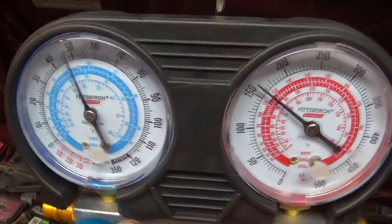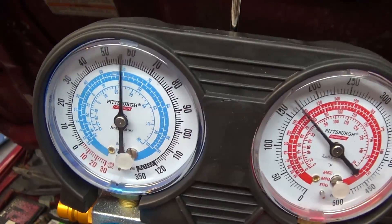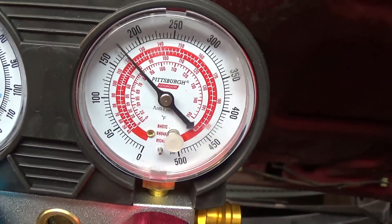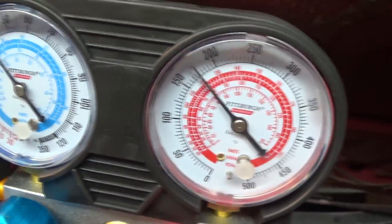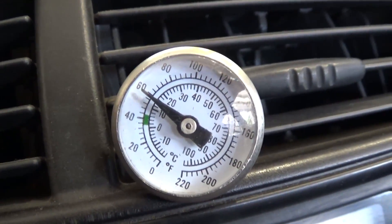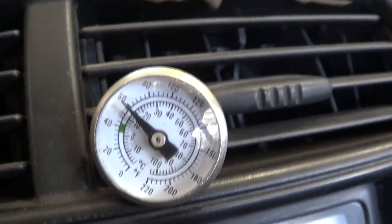It's pretty hot in here, so I'm going to give it a bit more charge — I'd say like low 40s PSI. High side is holding about 175 or so. The AC clutch is still going. Let's hop in the car and see how cool it is. At idle it's sitting at about 59 to 60 degrees. I'd say it's about 85 to 90 degrees in the garage right now, so it definitely could be better.